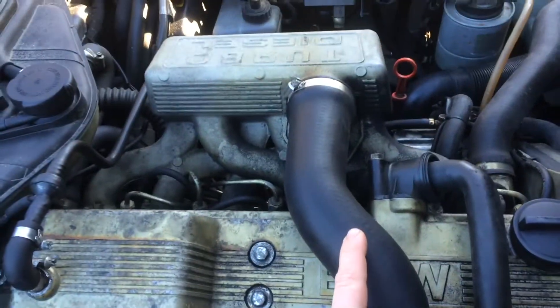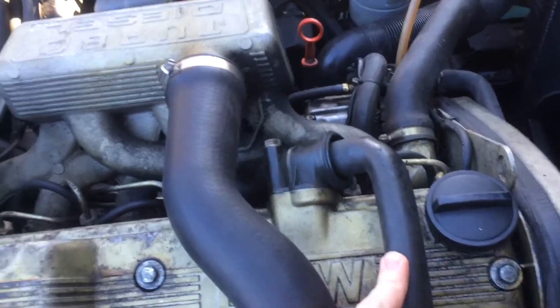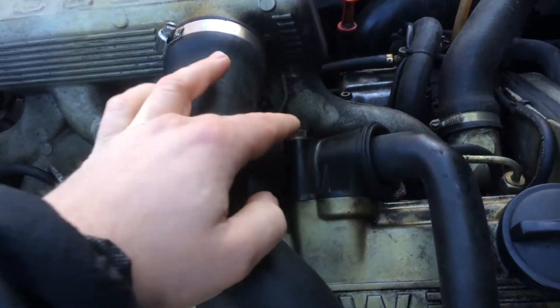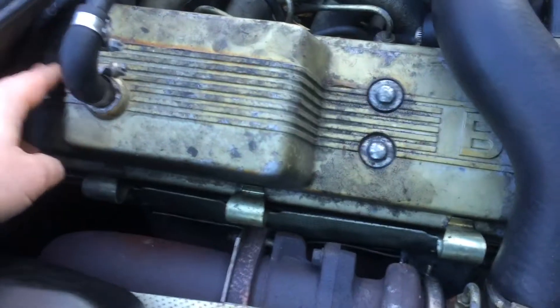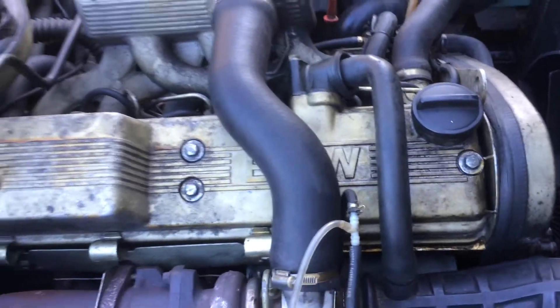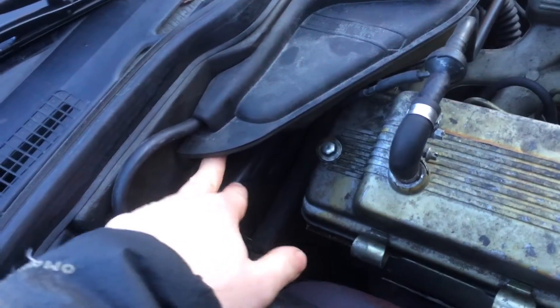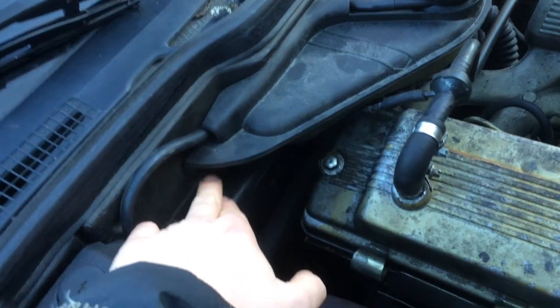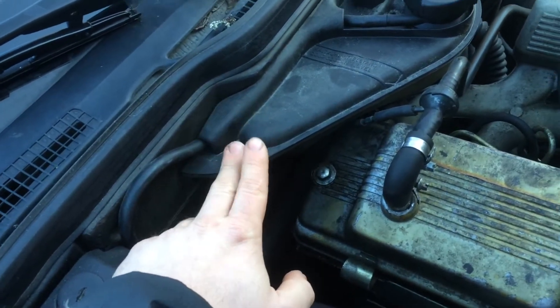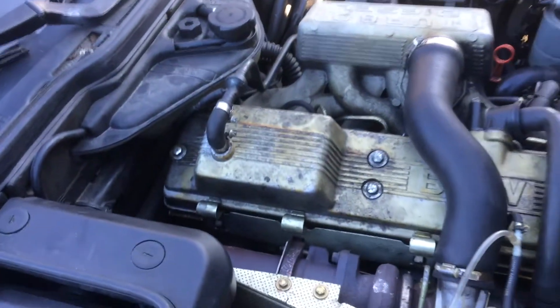You just take off the hose from the turbo to the intake, this hose here which is for the engine oil stuff, this thing here with one 13mm bolt, the hose from the vacuum pump, and these four — I think it's also 13mm bolts. Then you can pretty much just lift the valve cover off. To make it easier, there's one 10mm plastic fastener right beneath here — take that off and pull this tank a little bit out of the way.